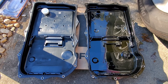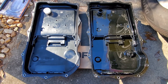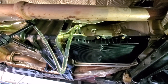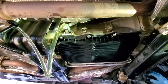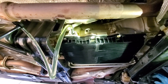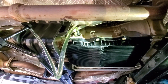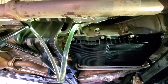Find your torque spec in the service manual or whatever the ZF transmission calls for. We got the pan back up, tightened the pan bolts to spec with the correct torque sequence. Make sure you pop it in place and get everything lined up finger tight first. Now we're going to start the fill procedure. You're going to need a way to monitor the transmission fluid temperature — there's a specified range. The sticker on this one said between 100 and 128 degrees to check. We'll fill it with about one to two quarts, it'll start to run out, then put the fill cap back on, start the truck up, and monitor transmission temperature either from the vehicle's gauge or a scan tool capable of reading transmission temperature.